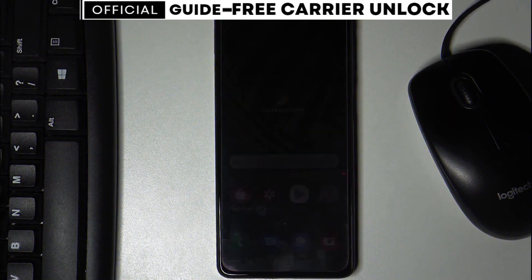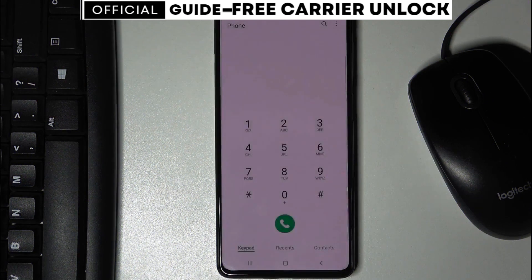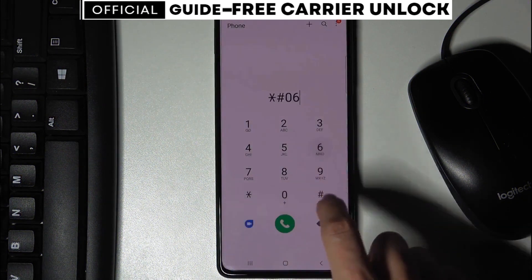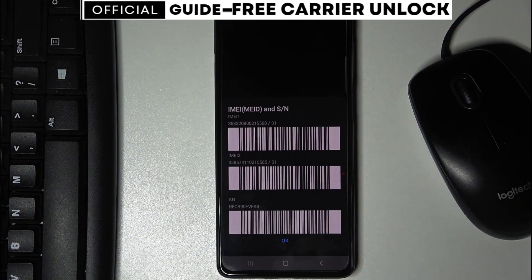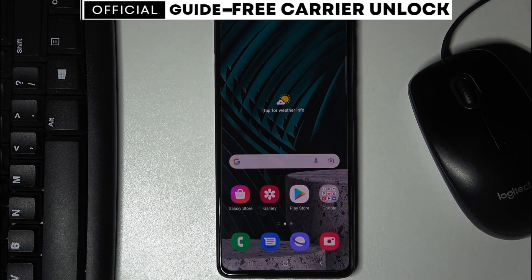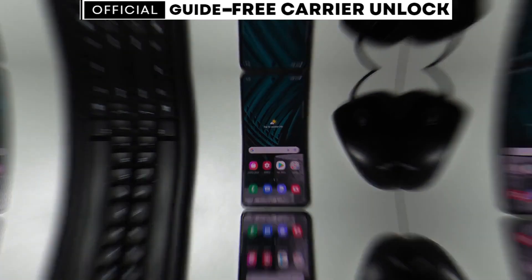To begin, we're going to get the phone's IMEI number — that's a unique number for every phone. To get it, simply dial *#06#. As you will see, your 15-digit IMEI number will appear on the screen of your phone. This number is very important; it represents the ID of your phone. Keep it somewhere close because we're going to use it in a few seconds. Now we're going to switch to the computer.